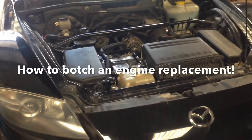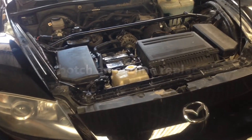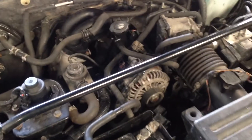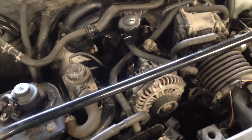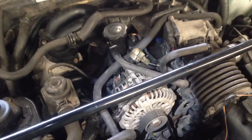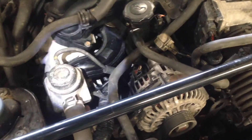There's an RX8 coming in today. Notice there's no headlight washers and it's a five-speed RX8, so essentially a four-port or 192. However, on closer inspection it's been fitted with a 231 engine — the six-port. You can see the additional intake runners.